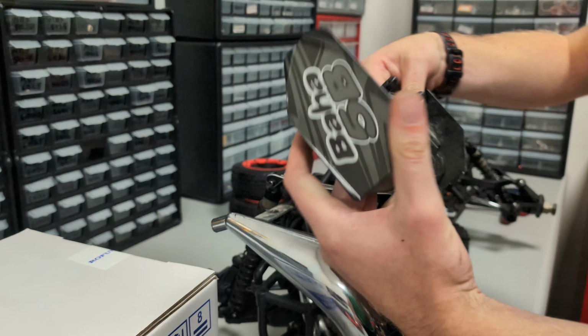And then there's usually a couple gaskets back here. You just want to make sure you don't lose the gaskets. Here, these are the gaskets that I'm talking about. Got both screws off. Okay, and then on the exhaust there's usually 2 bolts on the engine, and then there's another bolt that just holds the bottom of it together. So this is just a smaller screw. There it is.